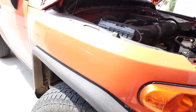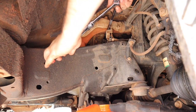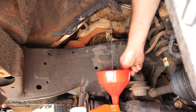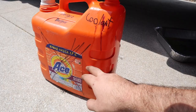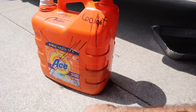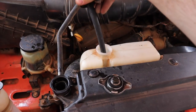In our truck we come to the left side right here under the wheel well. We have a little bolt here with a spout — we just take off that bolt and through this tube, the coolant from the engine will drain. Use a wrench with a couple of extensions to break that 10mm bolt loose, and let the engine drain. Our petcock is completely drained. We let the engine drain here for a while, then we can close it back up. With that, our engine plug is completely drained — take a look at that level. It is very important to drain your engine as well; there's a lot of coolant still in there. If you don't do this, you're not properly draining your system.